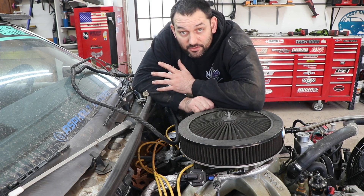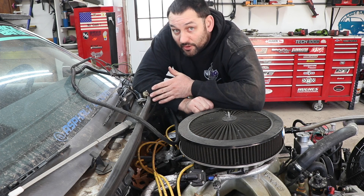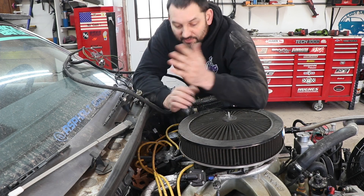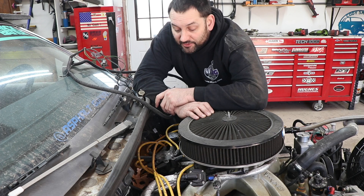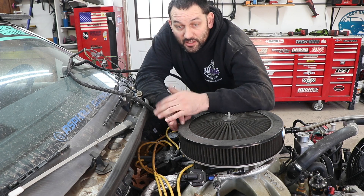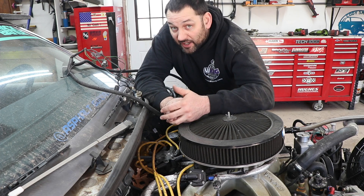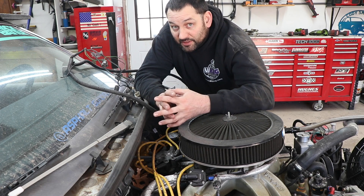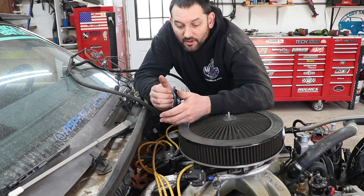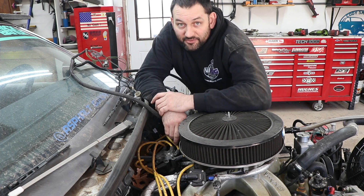The reason for which is that your tune is off. Typically, whether it's rich or it's lean, it's going to cause the engine to run hot. Now these cars are old — they all develop problems over time, especially if they sat for a long time. The biggest thing with your distributor is you can have weights get stuck or a vacuum advance that's malfunctioning. If you're having problems with hard starting or it just running really hot really quickly, timing's the first place to look.